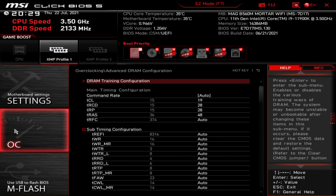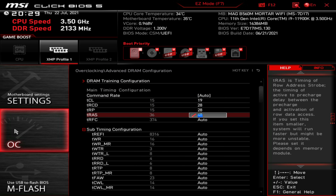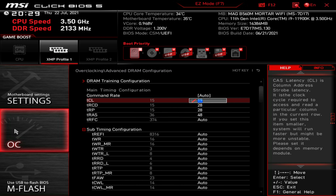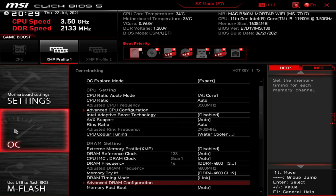So if I go to Advanced DRAM Configuration, I've got a few settings here. These timings are fine — it's a little bit tighter than the factory timing. But what we need to do is loosen up the CAS latency. 19 is too tight, so we drop it down to 22, and we should be in business. That's all I needed to do to get it to work at this speed, and this is the fastest and tightest I could get out of this kit. So let's save those settings.